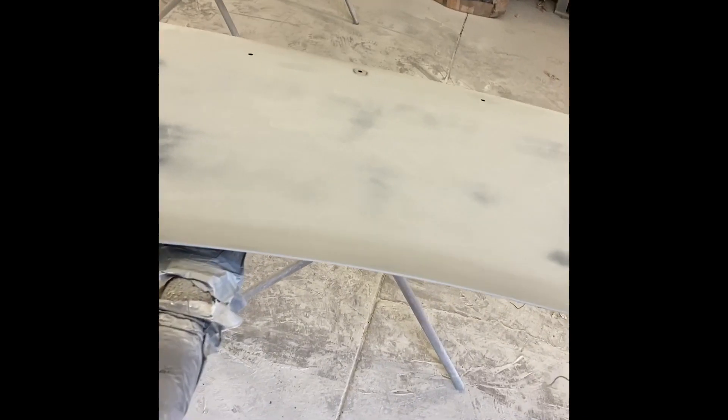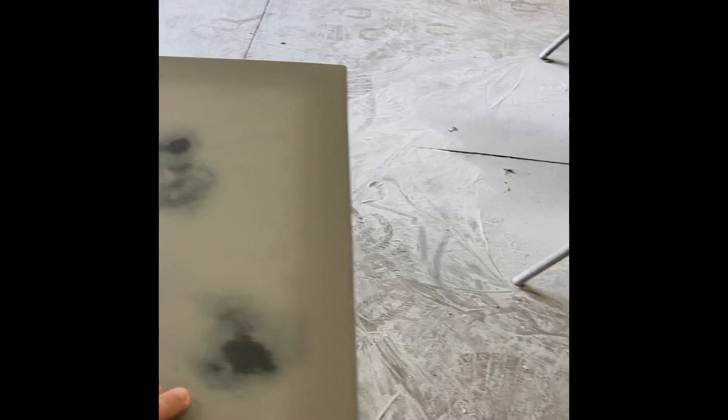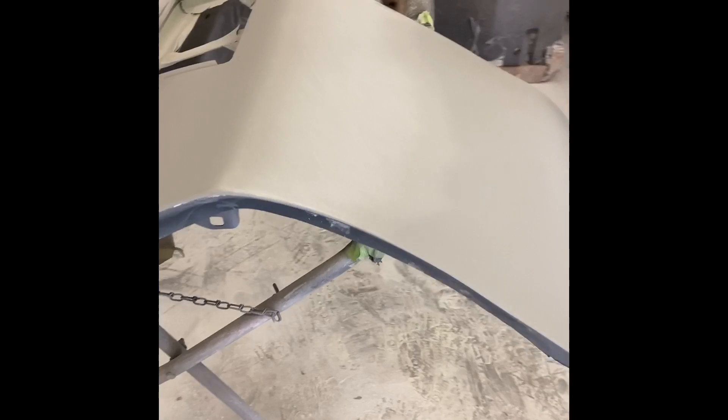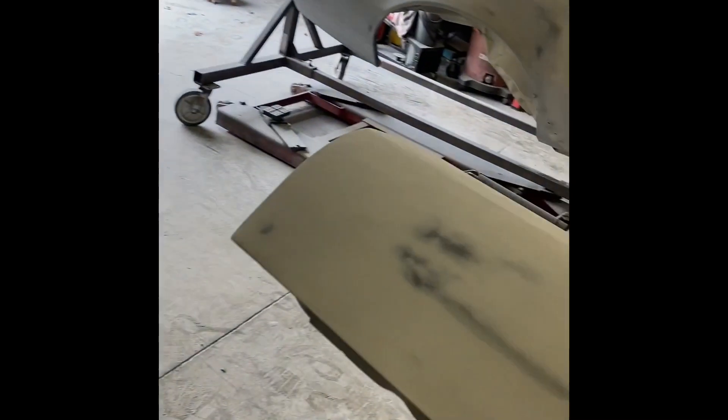The trunk — I sprayed a coat and then sanded it with 180 grit. All that stuff we had shown you before, you can see all the little things are filled. I've gone over this with 180. I'm just now starting with 180 grit to break through blocking the whole thing. As long as I don't go through to metal, the next coat that goes on — like this trunk lid — is going to be the two-part polyurethane primer. Everything got done that way. This has just one light coat of polyester on it, and I've already gone over everything with 180 grit.